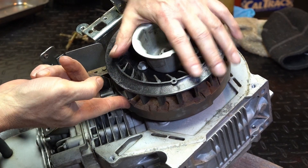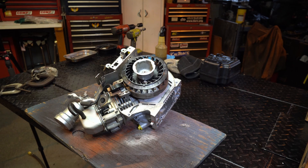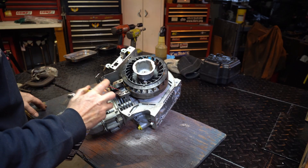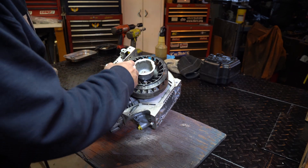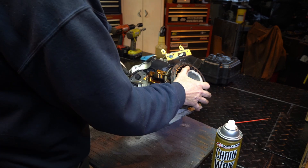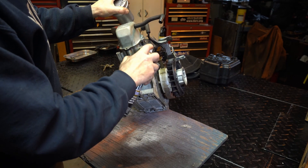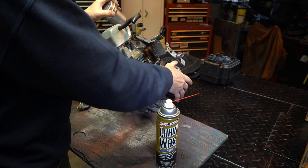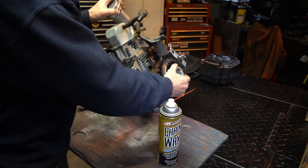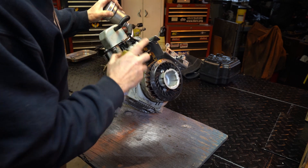Now I'll show you another little trick. Just in case this thing is in wet operation — you can keep the rust off and avoid electrical issues. Put some oil on the coil itself, the magneto. Briggs calls it the Magnetron, I think. Put a little bit on the flywheel too, and that'll keep it from rotting up, especially in wet operation. You can also use cosmoline, which is awesome stuff. It also works good if you want to improve gasket performance.